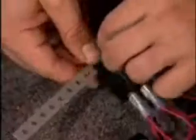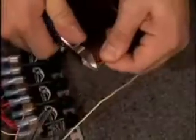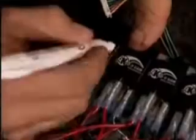Once the relays are wired, you can wire tie them to a short length of perforated strap along with the control unit. Then, cut off the unused wires and wrap them each with electrical tape, and label each relay with a paint marker to prevent confusion in the car.